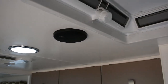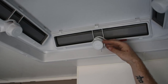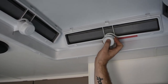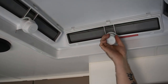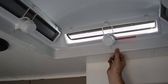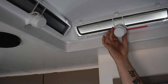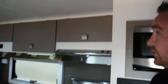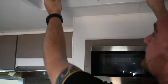Above us is a Four Seasons hatch — there are two of these, one at the front and one at the back. The purpose is to direct the air through the caravan wherever you want it to go. With the amount of LEDs in this van, it is nice and bright, so you don't need a skylight. You've got four vents all around the outside. To use them, you grab the handle, twist it, and you can see that opens up. If the wind's coming from this direction, it's being forced in through the van. If it starts to rain, you can close it with the rain setting — air still comes through but the rain doesn't. The vent cover also comes off for easy cleaning.